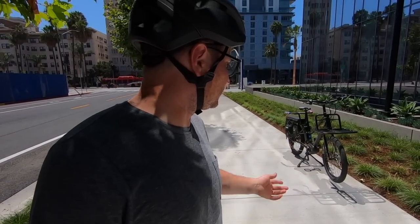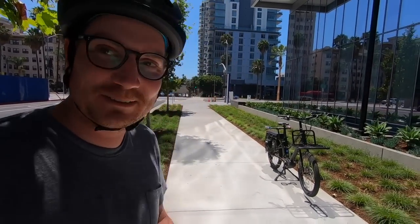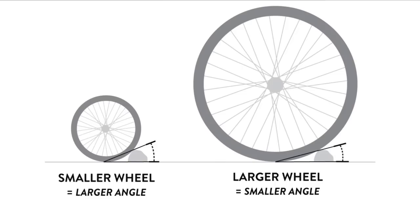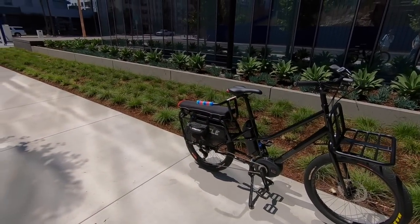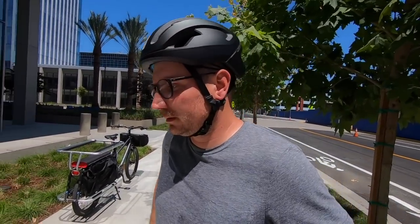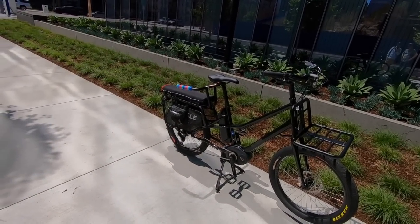The smaller wheel in the rear brings the rear rack even lower and provides extra strength, but you end up with two different tube sizes and tires to deal with. Their newer models are going with 24-inch on both. For a smaller rider carrying a lot of weight it might be easier with a 20-inch rear for a lower center of gravity, but the matching 24-inch wheels extend the capabilities and give more of a traditional bike feel. These tires are actually BMX-rated — it even says 'made for professional use.'